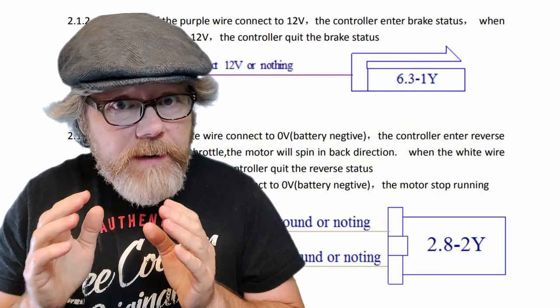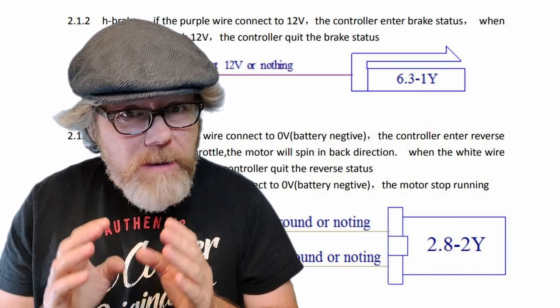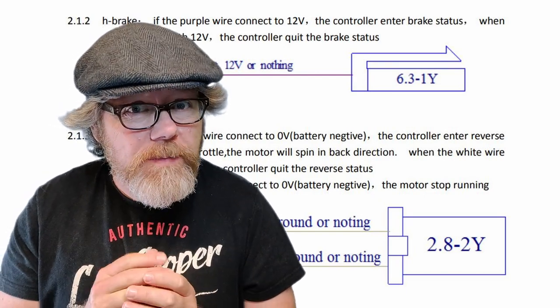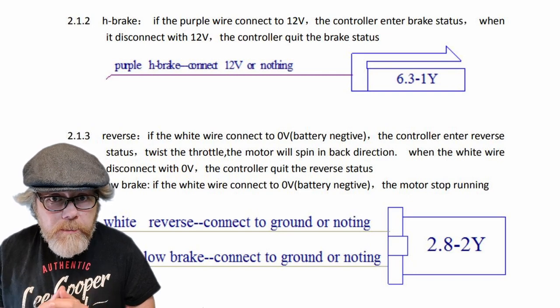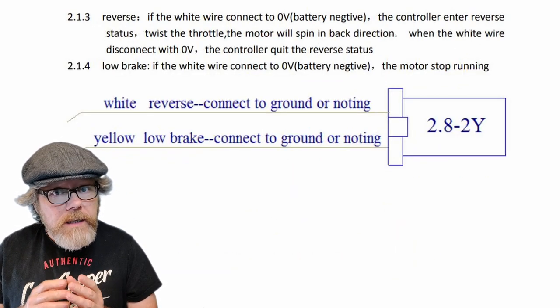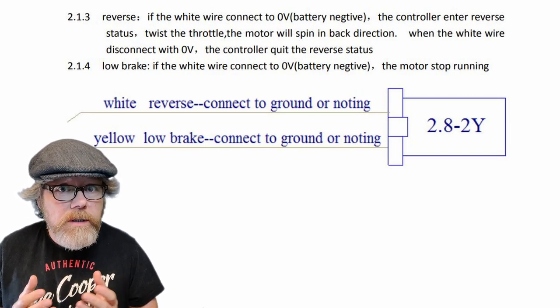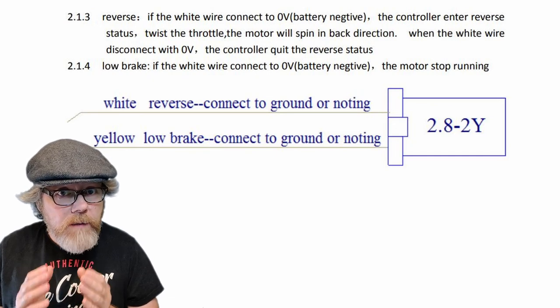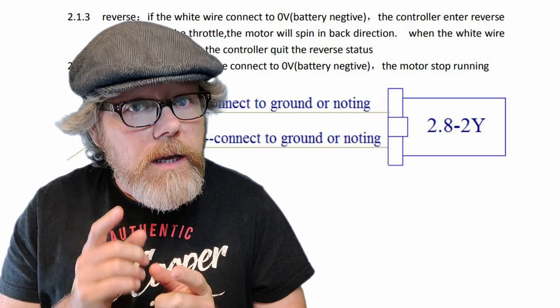Another thing I'd like to mention is that when you buy something from China, from AliExpress for example, the documentation or instructions are pretty vague. For example, I've put a reverse switch on and it says connect to the zero volts or negative of the battery. That worked with the 72 volt negative of the battery. But underneath that, it talks about the brake — when you pull the brakes it cuts the motor — and that also says connect to the zero volt negative of the battery. When I put that on the 72 volt negative battery, nothing happened at all. But when I connected to the negative of the 12 volt converter, it worked like a peach. So it's very vague with what they say. Why not put a little bit more information into it?